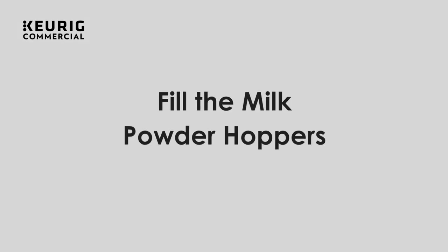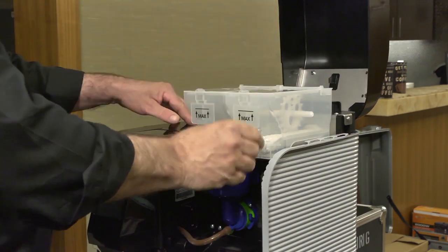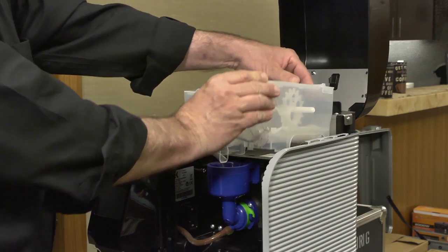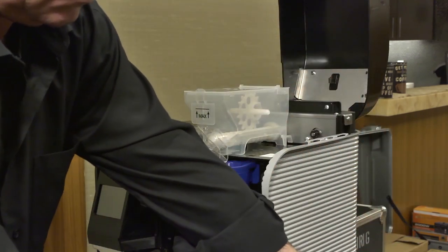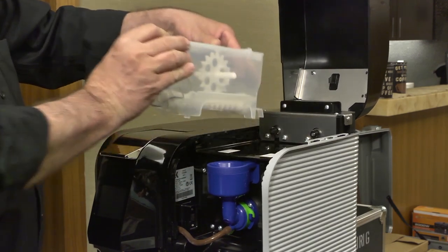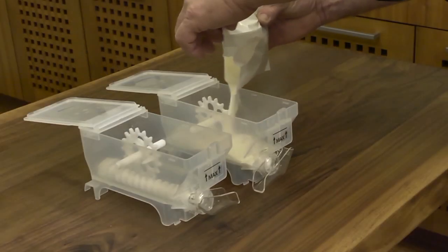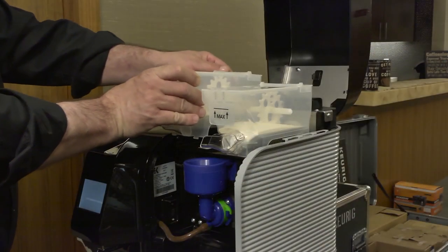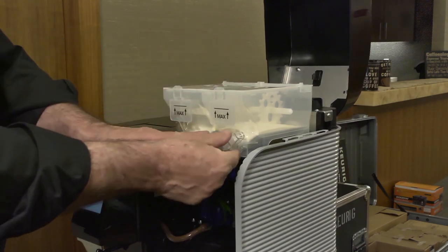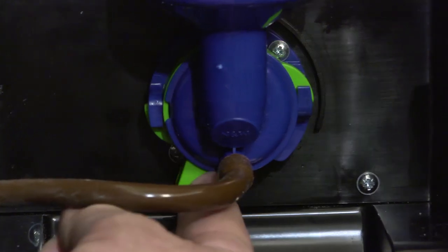Fill the milk powder hoppers. Open the lid on the front of the K4000. To fill the powder hoppers, you will need to remove them. Adjust the clear plastic spouts in front of the hoppers to a horizontal position. To remove each hopper, gently push the front face back and then tilt up a quarter inch to unclip from the holder. Slide the hopper towards you to disengage and remove. Do this for both hoppers. Each hopper holds one one-pound bag of powdered milk. Do not overfill. Once the hoppers have been filled, place them back inside the machine. Turn the spouts back to their original position, where the long ends are pointing down into the mixing bowl. Be sure that the bottom of the mixing bowl is locked before closing the lid on the machine.